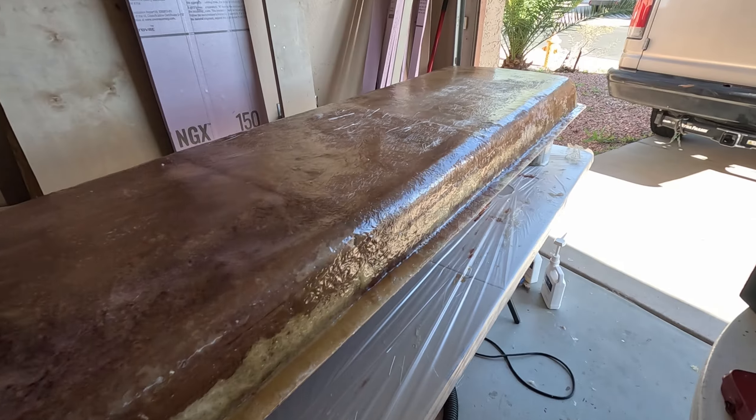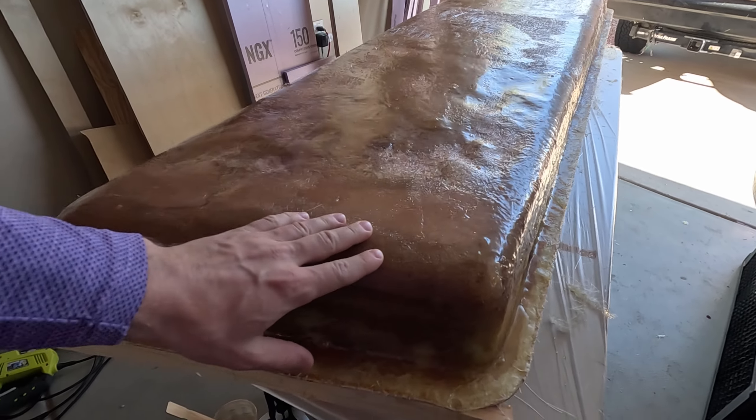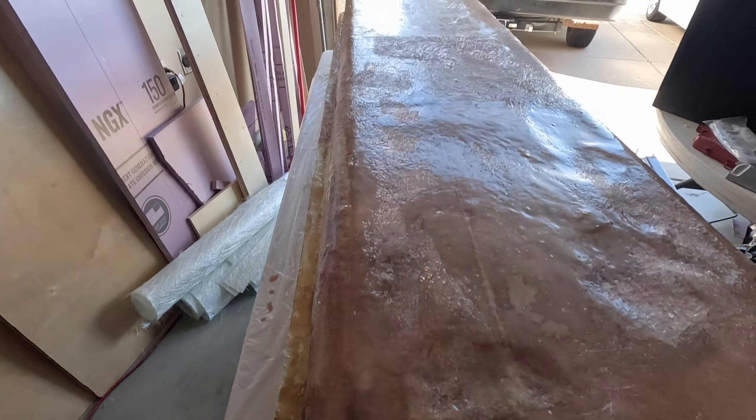Give this a little bit more time to dry and then get some more sheets on top of it. I'm thinking because the fiberglass is pretty thick, two layers should be good - in some spots it's more like three layers because of overlap. Then I'll be doing the gel coat on top of that and also the Bondo putty. So I say one more layer of fiberglass but it's really like three more coats of a hardened resin, and it should be pretty solid. It's been over half an hour - let it dry to the touch - so let's get some full sheets on there.